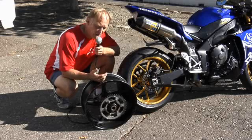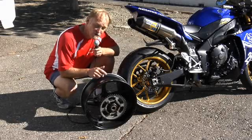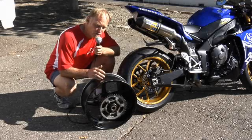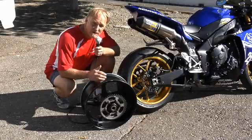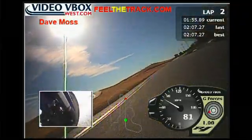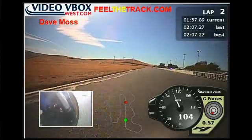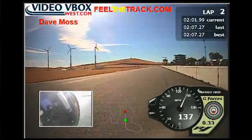Well, as you accelerate, it's going to take obviously less power to turn the wheel. So therefore, if you've got 3.4 pounds less weight to turn, the bike's going to accelerate faster. So that makes coming off the corner, when I go out and ride later in the day, it's going to be real interesting to see how the bike drives away from the corner based on that.